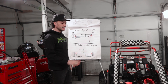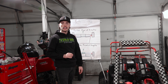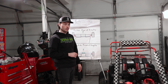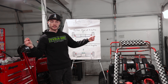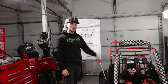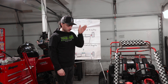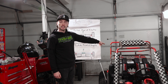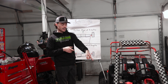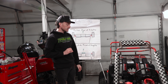It's not too crazy, and it becomes even easier when it comes time to figure it out on your actual go-kart. The way that I like to do it is — ideally I wouldn't have the seat and engine in my way — but all I like to do is grab a piece of string, tie it to either the rear axle if I can reach it, or somewhere in line with the rear axle. I'm going to tie our string right here to the back of the cage — there's a spot that falls right above our rear axle, and that's going to be our center point. Then I just stretch my string out until it meets the kingpin, and you'll see that on our cart, our tie rod attachments are right in line with that. And we have really nice Ackermann steering.